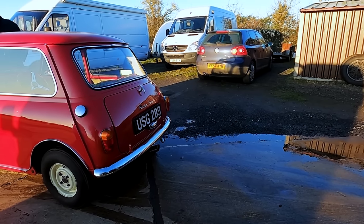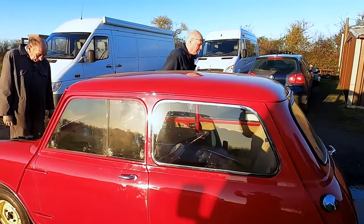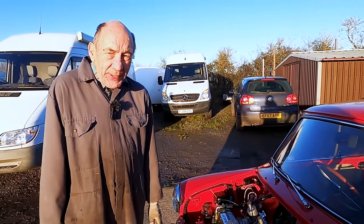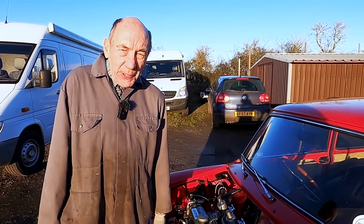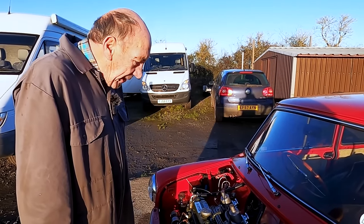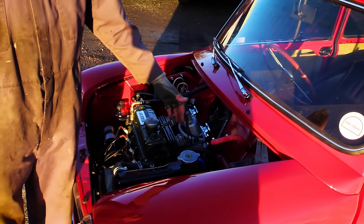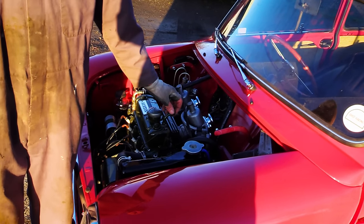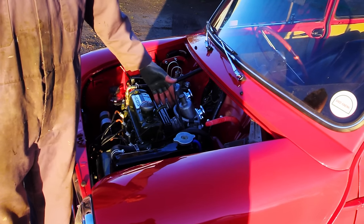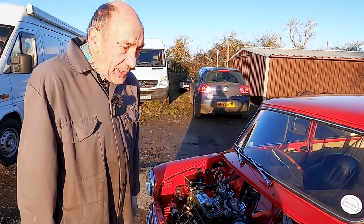Dynamo's not charging. Yeah, well, it's exciting, because we've reversed the polarity. John says the dynamo's not charging because we reversed the polarity, and it needs something. Exciting, that's the word. Not breathing at all, look. Obviously changing the piston rings around ain't done that much damage at the moment. I'm quite pleased with that, really.